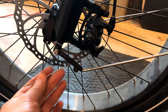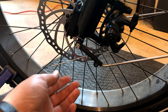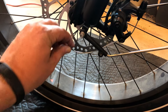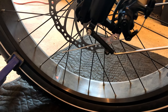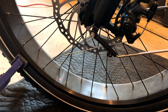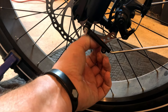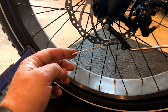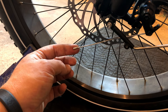You'll also notice there's a lot of cable sticking out of the brake caliper. This is not a good situation — if it gets moving around and gets caught in your rotor while the tire is moving, it could suck back in here and lock the system up, which would throw you over the handlebars. So at the end of the video, when I'm done with the fine tuning, I'm going to clip this off about an inch or an inch and a half out and put a new end cap on — I'll have the link to those end caps in the description.